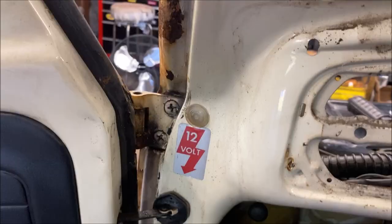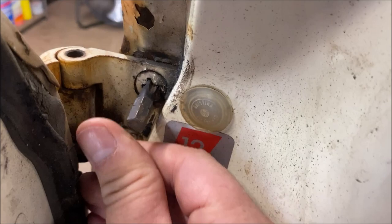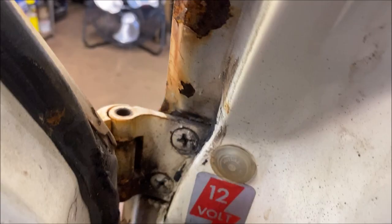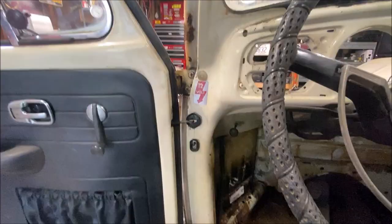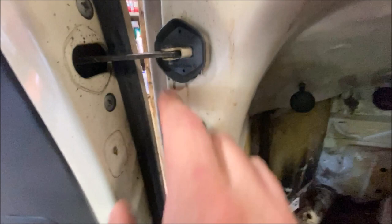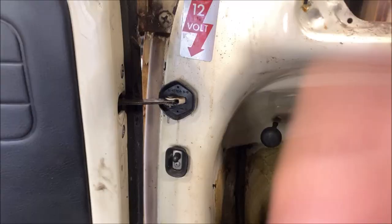They're not very easy to find, but I'll show you how big these screws are. Here are the big guys — I've got to pop the caps off. The factory caps are still there for the inside ones, but that is a number four Phillips. And they're big — I'll put my thumb next to one so you can see. First things first, before I attempt to pop these screws loose, we've got to remove these little fingers — a little spring with a clip, like a horseshoe clip. I'm going to pop this off, show you what it looks like, then pull the pin and get that out of the way.